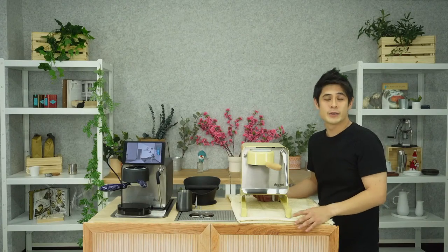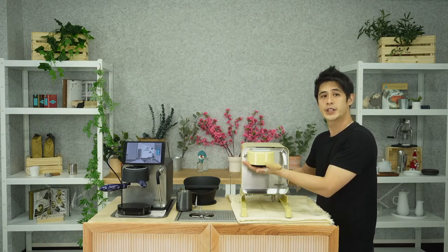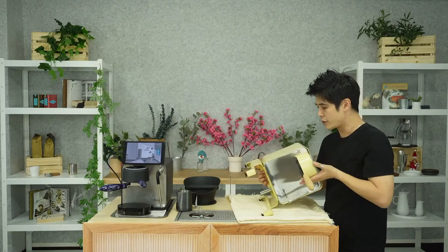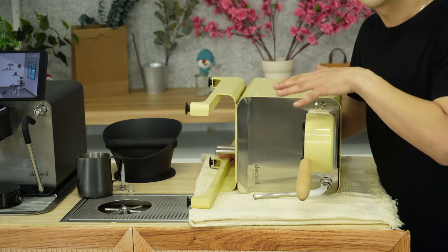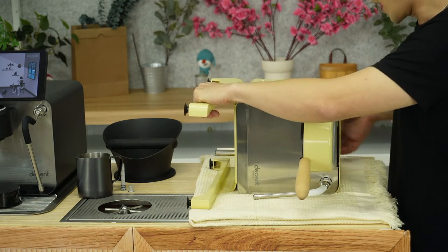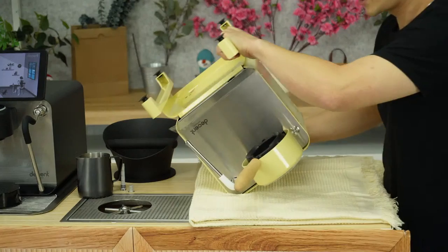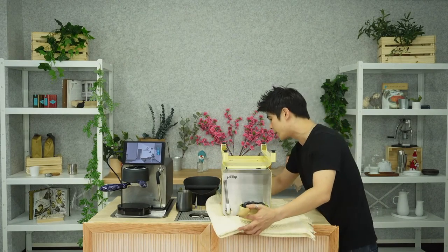Before you put everything back in, it's a good opportunity to give things a clean and check out your thimble. The access point is underneath the group head and just underneath the chassis — just lift up a little bit and then tilt. The next resting point is just on the side. If this is the first time flipping a D1, you'll want to get used to the weight and the holding points. Once you're there, the next holding point is the leg base and just underneath the top of the cover towards the back. We'll steadily lift it up, slide it under, and rest it — then move it closer so you can see from the top-down camera.